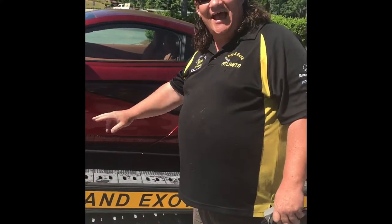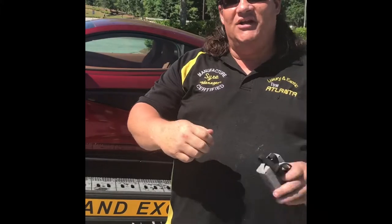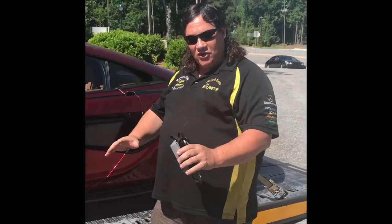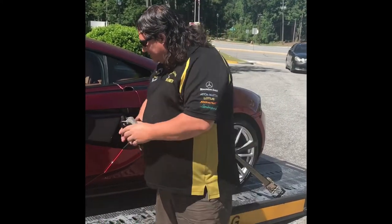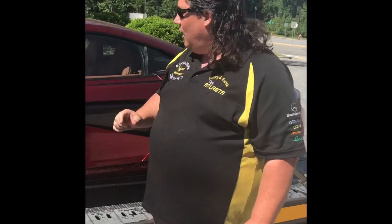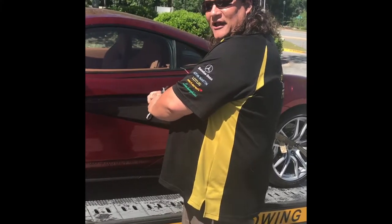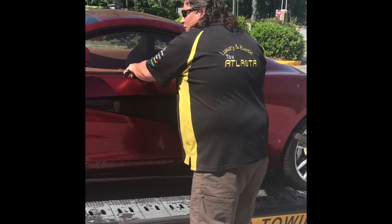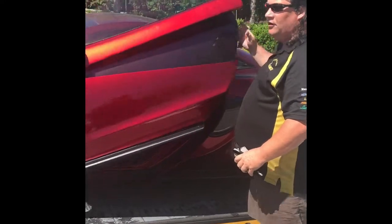I'm going to show you a few little tricks. If the vehicle is locked and the power is dead, it takes two people to unlock the vehicle — two people. One person with two hands to turn the key, another person to push down on the door. The door is pneumatic, so it's locked in place. There is a lock cylinder under here. You take the key fob, very gently remove the fob and take it apart. You will find a funky-looking key. That funky-looking key is what you need. Once somebody's on the ground, you will turn it clockwise a quarter of a turn, and then the person opening the door will push down and you can raise up the door.